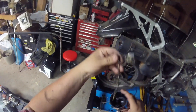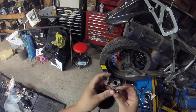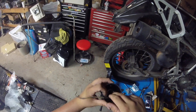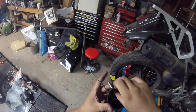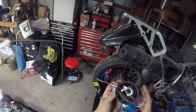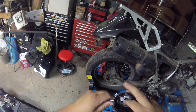Pull your wires through and all this comes right out the front. Now before you put everything back together, pull the wires through that bracket and get the old nut off - it doesn't need to be there. Then stick that light bulb bracket back down in there, take your adapter, slide it through from the inside, then feed the wires back through, pull the slack out, feed those back in there - it needs to look just like that.